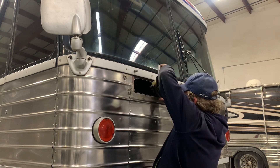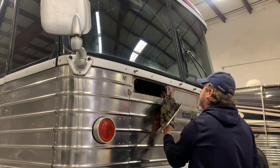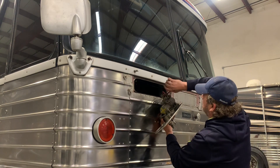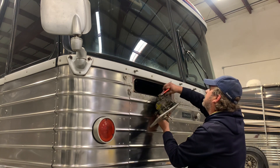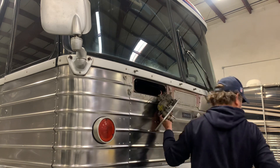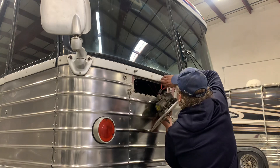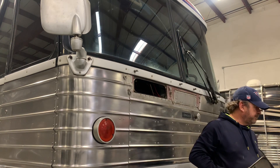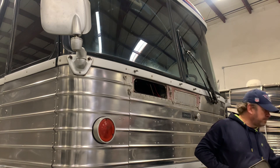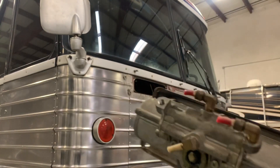You have to move things out of the way sometimes to pull it out. There are three air lines: one is the input pressure, and then there's kind of a little drain line that runs down underneath the bus — if you don't have that it makes a constant hissing sound. I want to clip these because I'm going to go through and replace them with the push-to-disconnect new type instead of the old compression fittings.